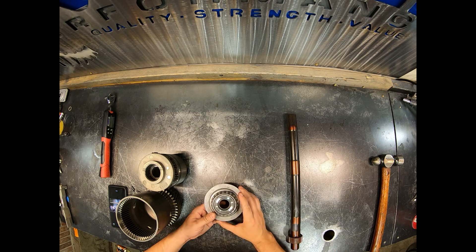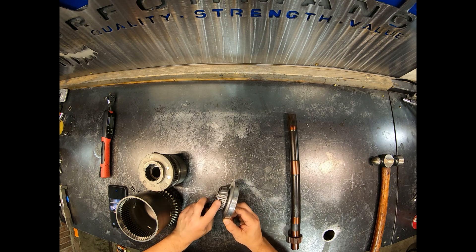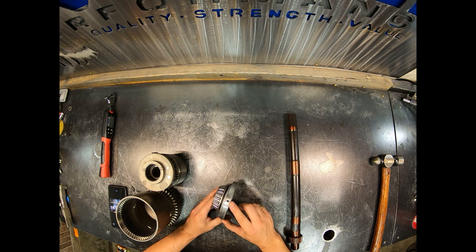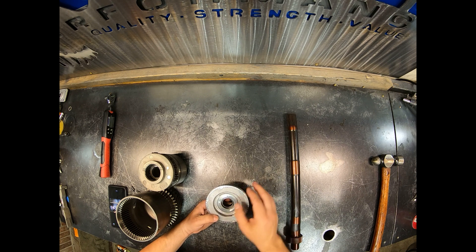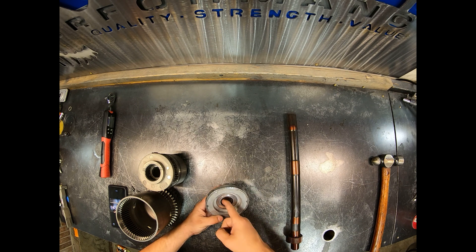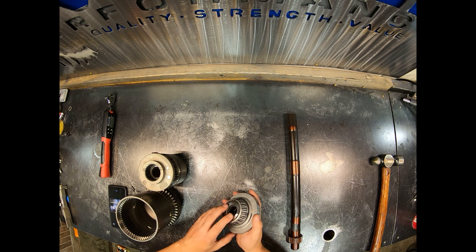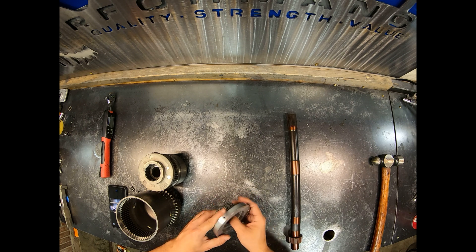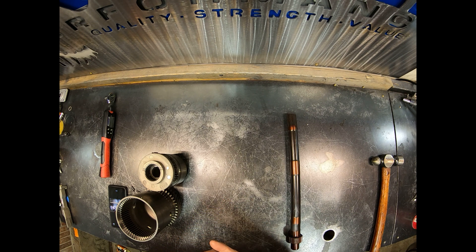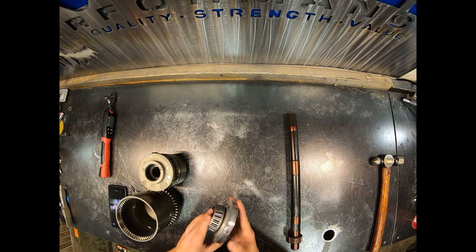The other small piece is basically the cap for the center differential. This contains a bearing and it secures to the case through four holes around the perimeter — roll pins go in from the outside of the case through this cap and hold everything together. There's also a little needle bearing in here; just make sure it's not all scored up. They really don't fail often, but the part number is HK 2520 — INA makes that bearing and you can get it pretty readily. It will just drive out on this setup.